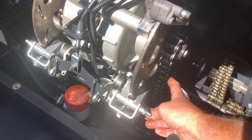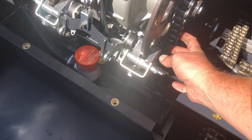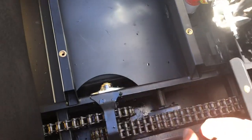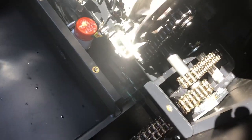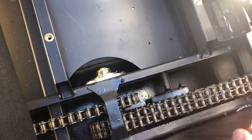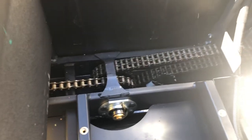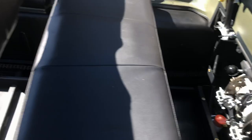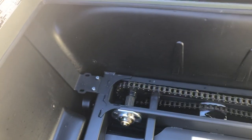These are your idler chains — we've got those nice and tight, about one-eighth of an inch of deflection as per the manual. Chains are nicely oiled, which is what you want. You don't have to have oil dripping off them, but just make sure they're oiled. If you get water in it'll wash the chains and you'll have to oil them more often.